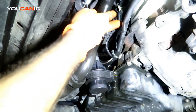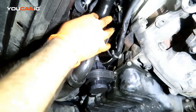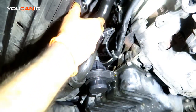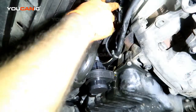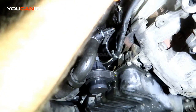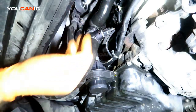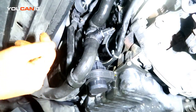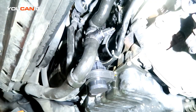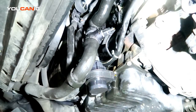You may have done this without removing the cold air intake. Alternatively, you can remove the cold air intake by removing two T30 bolts, a connector on this side, and the connector up top that goes into the intake. That's how you replace the coolant temperature sensor on your 2014 Tiguan TSI. Thanks for watching — you can be the mechanic.